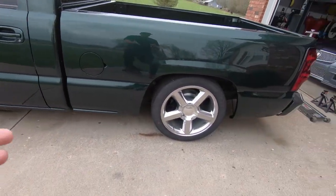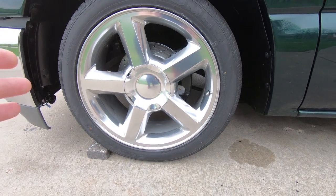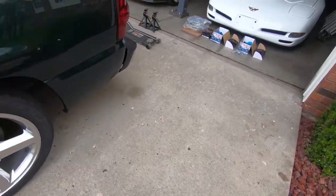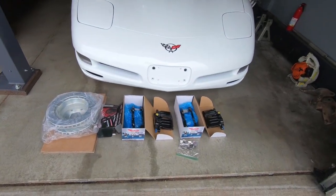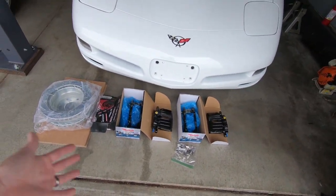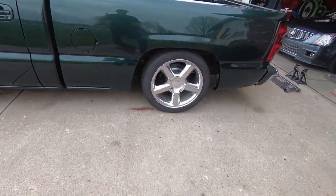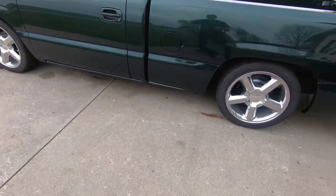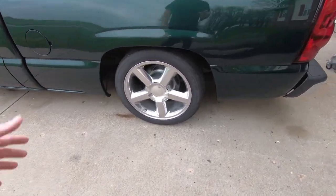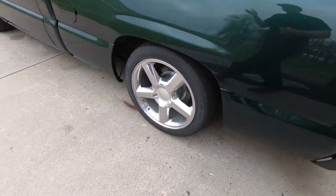The downside is I spent all that time painting those green and that paint wasn't cheap — it was G2 caliper paint, which I'll list down in the description below. While they do look really nice, it just sucks that I had to repaint the replacement set. So what are we going to do? We're going to upgrade — go to the dual piston in the rear. That does require a new brake rotor, new calipers, and new brake pads, and these don't even have probably 10 miles on them. Let's get this thing off the ground, get the wheels off and start this project.